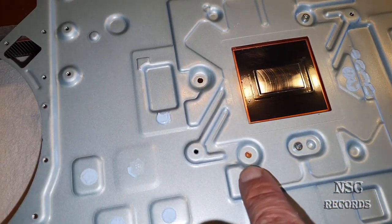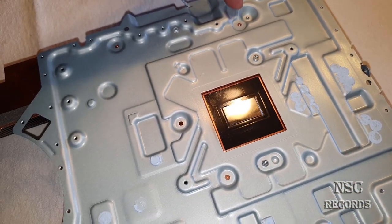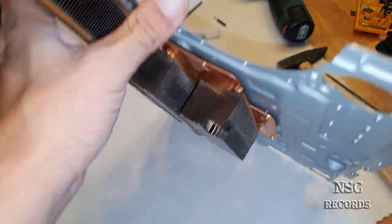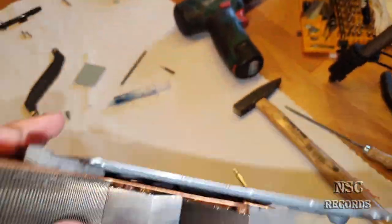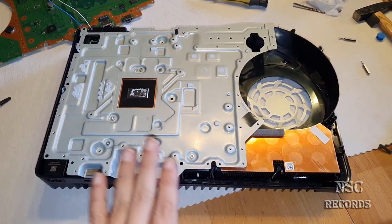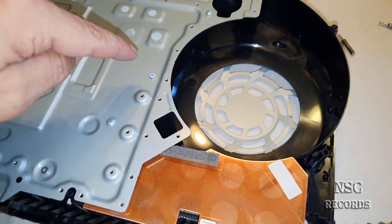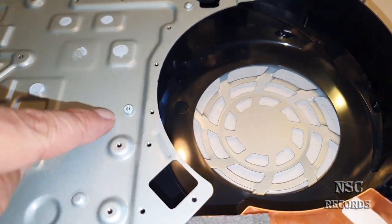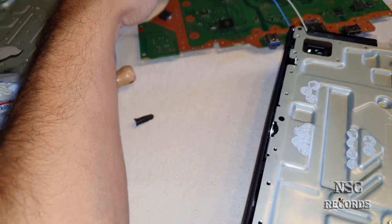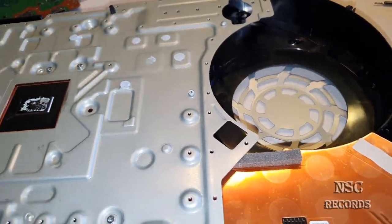Okay, but I just wanted to tell you about this hole here. This will be possible. And this already is there, this one not, because it's just not possible. The heatsink is in the way, it will just disturb. But it will be better than nothing, believe me guys. You can trust my work. So I'm just testing right now to get this all back in the case, and I have also done a hole for the screw on the side here. I have also put some thermal paste here to see if the screw is gonna touch the motherboard. So this is about, I think, about here, this side here, and the screw is not touching the motherboard, which is really a great thing.